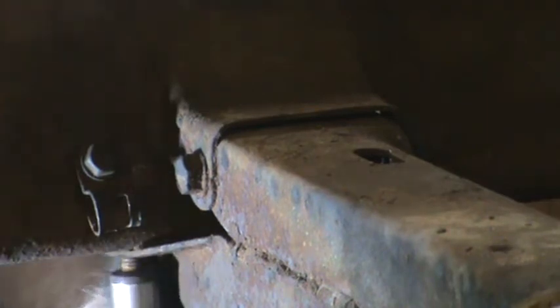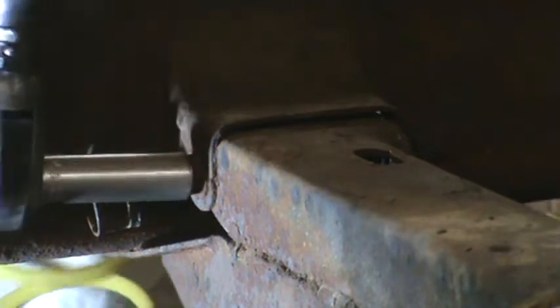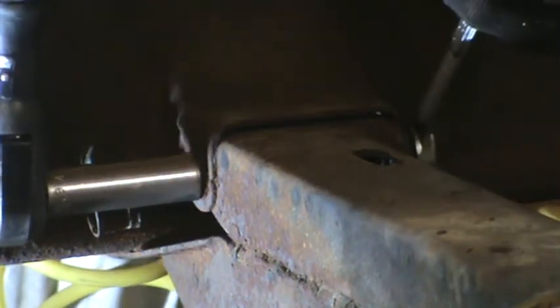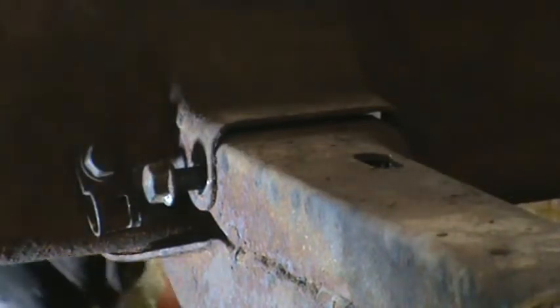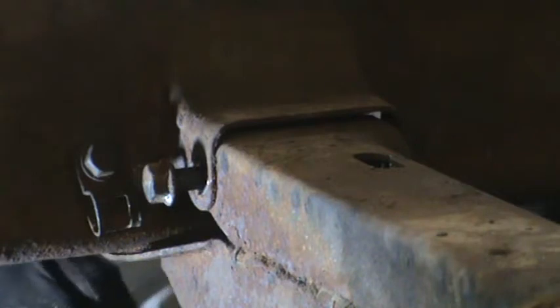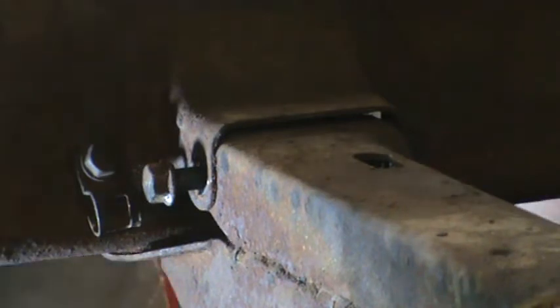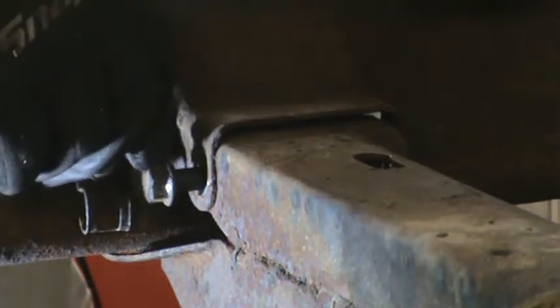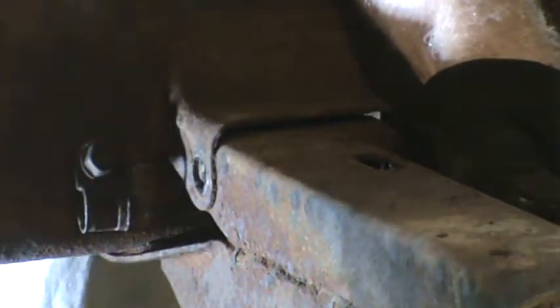I don't know if I'm tightening it or loosening it. Through. There are 9/16 inch sockets you need on this, on all of them. It actually was a little easier to use the socket on the bolt side rather than the nut side, because on the other side I did it on the nut side because I'm right-handed, and what happened is the nut went into the socket and it was a little bit difficult getting it out.